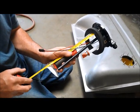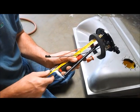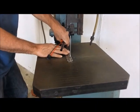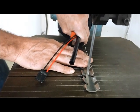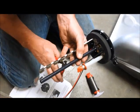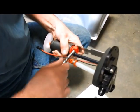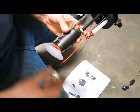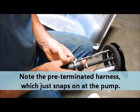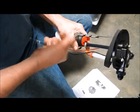Our fuel tank depth is 10 inches where the pump is, so it's got to be dead on with the depth — set at 10 inches. Now it's time to mark the hose and cut it. Preparing your pump assembly is basically a matter of putting the sleeve on the pump, which is more like a sound insulator, and then cutting the feed line to length, and then using a pair of hose clamps to attach the line and attach the pump to the support.